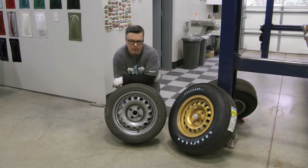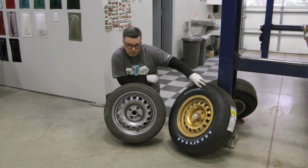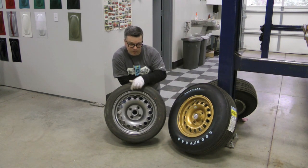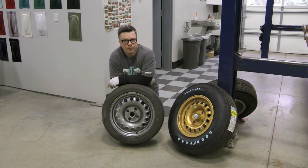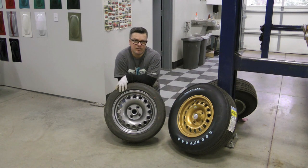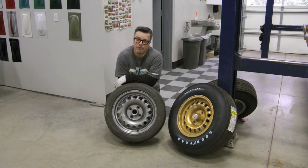This wheel on the right is an Alphaholics 15x7 wheel. Proportionately, though this is a smaller rim, the tire is significantly taller, so it looks like it's bigger - but in reality the 15x7 rim is bigger. If you're going to put new wheels on your car and want something that looks period, you can't really go wrong with these 15-inch GTA wheels. The reason is there's a greater selection of tires in the 15-inch configuration than the 14-inch. A 14-inch tire, you tend to pay more because production levels are somewhat less.